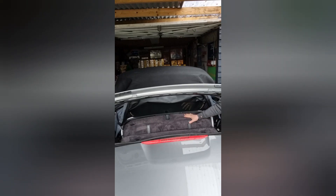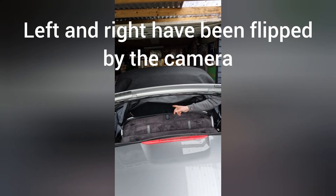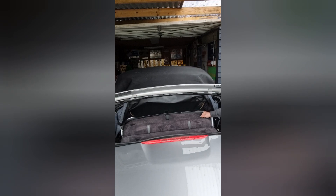Most cars are equipped with a storage box over here, so what we need to do is remove this — it's the same whether it's just an empty storage box or whether it's a Bose system. The Bose system has a plug on the driver's side on the right hand side, but basically what we're doing is twist these fixings 90 degrees, give them a wiggle and they'll lift up on both sides. Same again on this side — quarter of a turn anti-clockwise and then give them a wiggle. Once you've done that the box is loose to lift out, and it's very heavy if it's got the Bose system in it.